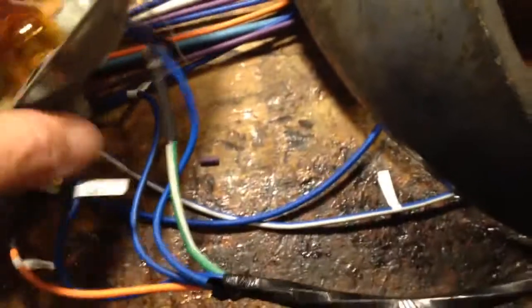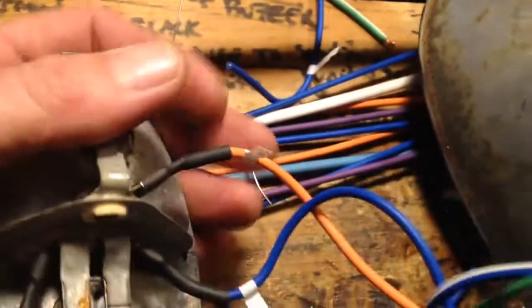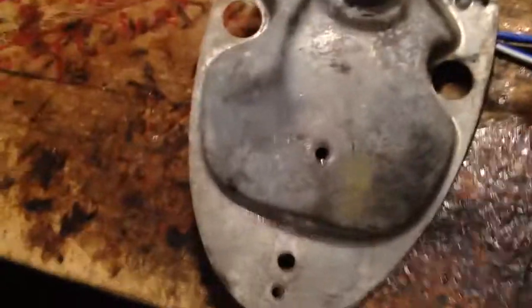From there the tail drops out right there — nice long lead. You should run it down the left tube of your buggy, and when it spits out the left tube's end you're going to have one lead for your left tail lights. I like Volkswagen units because they're kind of all in one. Always on top is turn, so you've got your left turn up there, your running lights, brake light, running light. When you plug this up, you've got to get this ground hooked to the body — or make it easy on yourself and drill a hole right into it and screw it right into the body. That way it works as well.